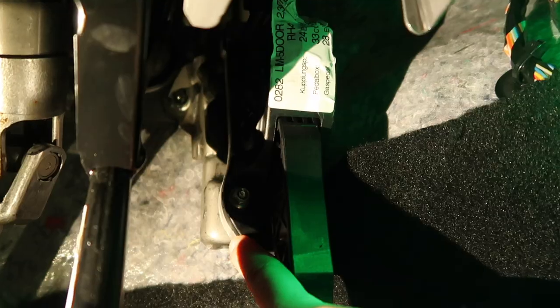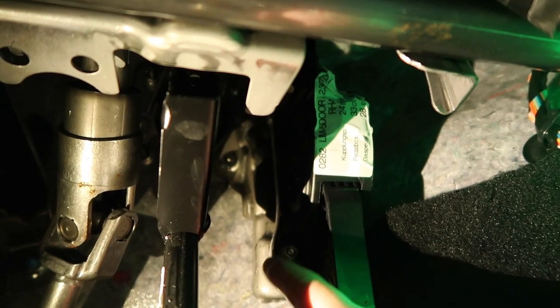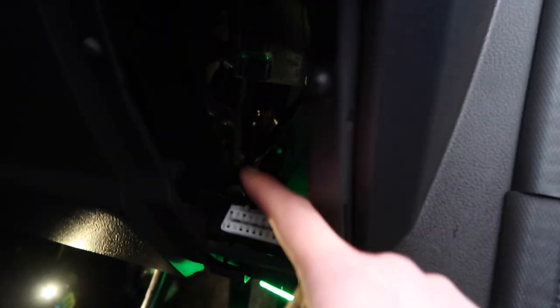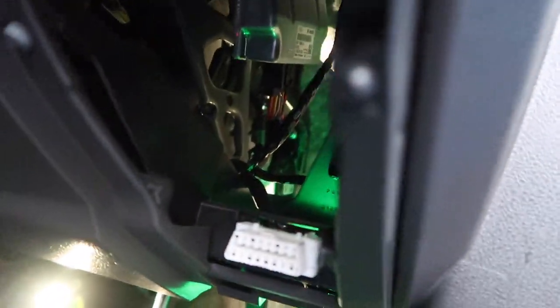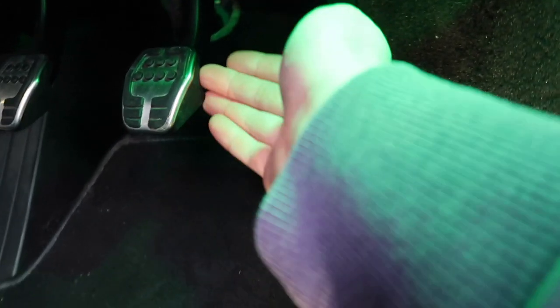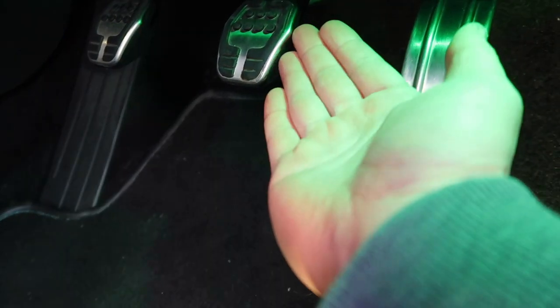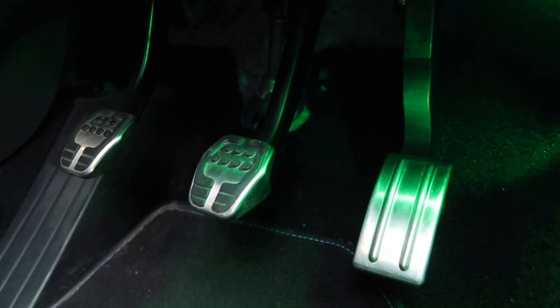A couple of top tips before I finish. You can see it's exactly lining up with the contours of the actual pedal — you need that to be perfect, otherwise it'll be very difficult to get the nuts on. Another top tip: if you're having trouble seeing, remove the cover of your onboard diagnostics port. That top nut is right in there so you can get a better angle and look through that gap if you're having trouble seeing. Hopefully you can see a difference — it is certainly closer. Any bigger of a spacer, and it would be right level. The Mishimoto, for example, is almost — in fact slightly more than — four times as thick, which would bring it right up level, which is just wrong in my opinion. Installation is complete — that's our two Steeda items installed for today.